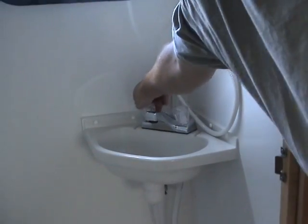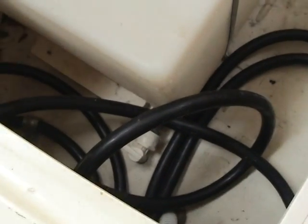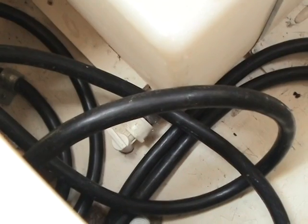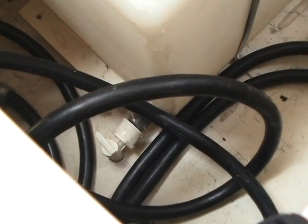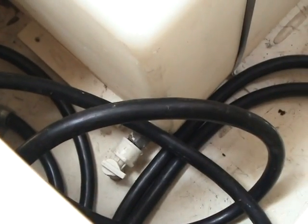Open all of the faucets including any bathroom, shower, or sink faucets. On the water tank under the rear seat, there is a petcock valve in the front left corner. Turn it 90 degrees toward the center of the trailer. This will open the valve and drain the tank, and should also drain the water out of the cold water lines if your SCAMP does not have a demand pump.